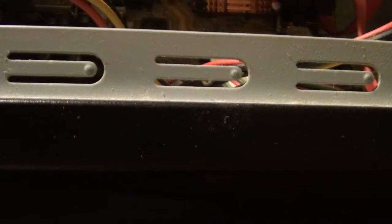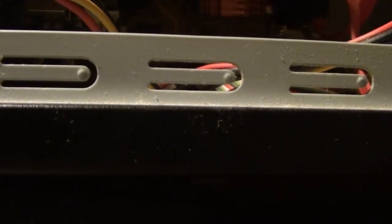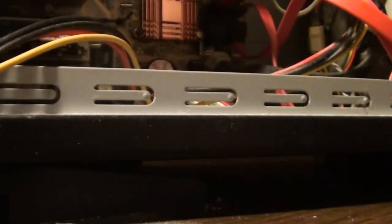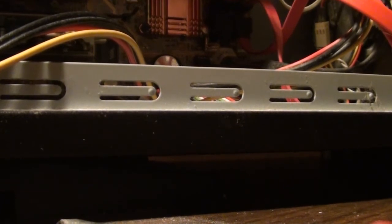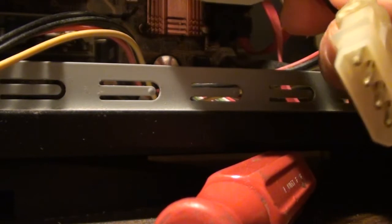Just a small, cheap PCI card - you can get these cards very cheaply. It'll work on any current PC. I'm going to get a screwdriver. If you look at the back of this computer, I have an empty slot. I need to plug the parallel port and the Molex power connector into the PC. The parallel port is clearly on the outside of the computer - that's going to be easy to connect. But where's the Molex connector? How do I get power off this thing?